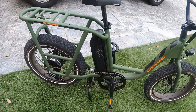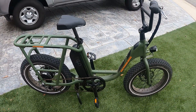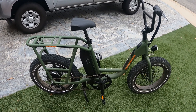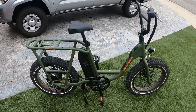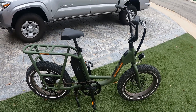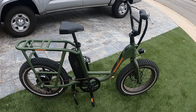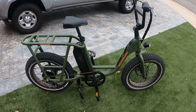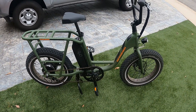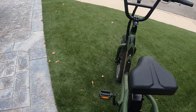On a nine speed bike, the single speed on this is pretty much like gear four — so it's got some low end but doesn't have any top end. It's pretty easy to take off from a dead stop, but you can't pedal much more than about 15 miles an hour because the gear is just too low. Compare that to the Rad Mission, which is like a little mountain bike, also single speed — that has basically gear seven, no low end, only top end. This one's nicer for hill starts and has 750 watts.